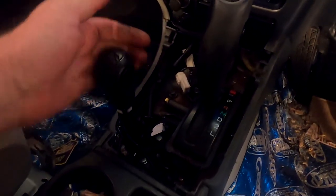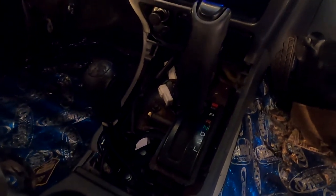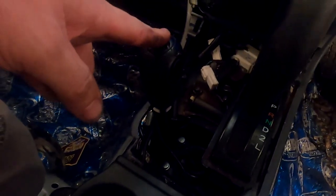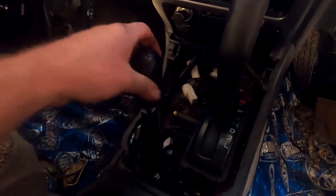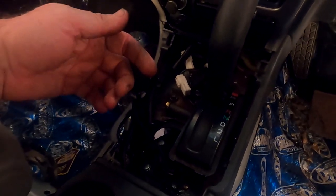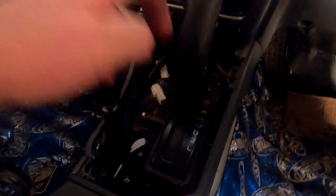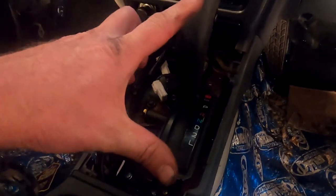The box is actually in neutral, but the box is still turning. Okay, no drive, nothing. Yeah, my brake doesn't work, because the drive shaft's up, but it's in neutral in the transfer case. So I can't stop the box. I have to stop the box, put it into four-wheel drive, and it goes in fine. But when I put it into neutral at present, the box can still turn. So realistically, it needs to go into park before engaging four-wheel drive. On the low four-wheel drive, this should be in park.